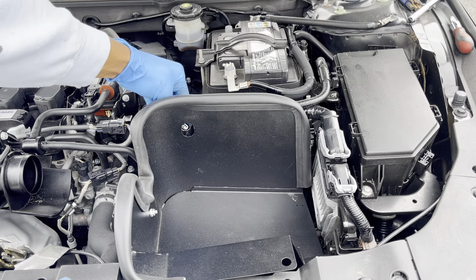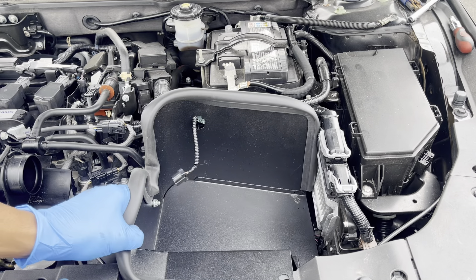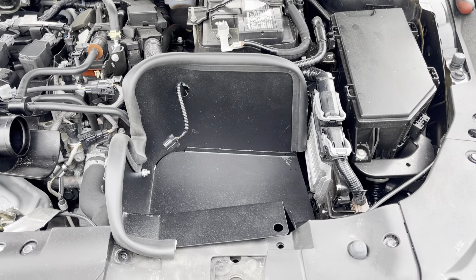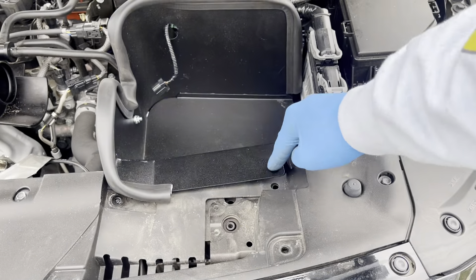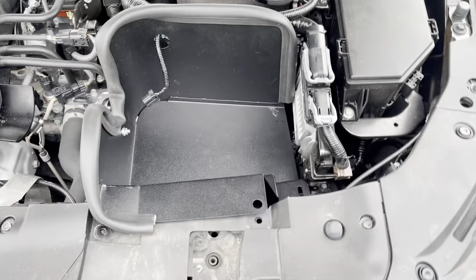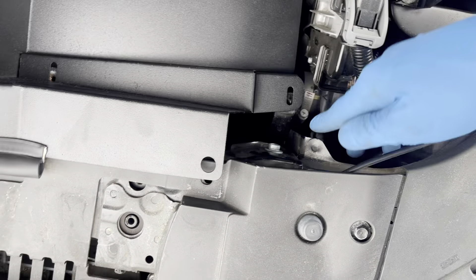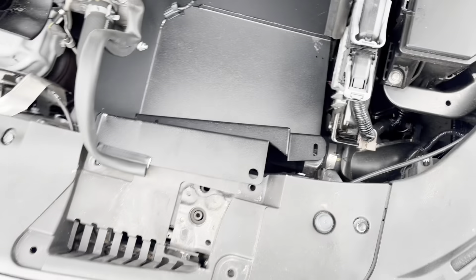That's installed. So we're going to slip the mass airflow sensor wire through here so we can have it ready. Next, we are going to put the nuts, bolts, and all the clips — move this down, put all these clips back. We're only going to need three — one for this, and then we're going to put the two bolts. That's the supplied hardware that's in the bag, we're going to put it in. Tighten that down.